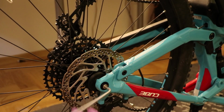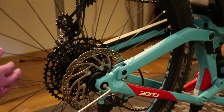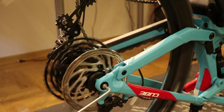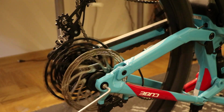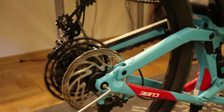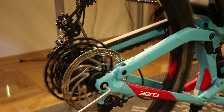As you approach the snug point on the axle, right when you feel the first resistance, I would like you to spin the wheel just lightly by hand. This is the amount of sound that the planet makes traveling around the Sun Gear. Okay, it's audible only in living room conditions, and as soon as you are on the road or on the trail, it will be absolutely quiet.